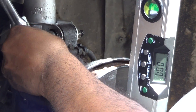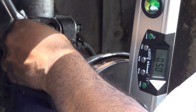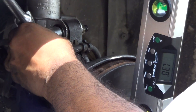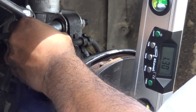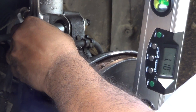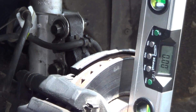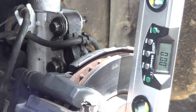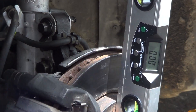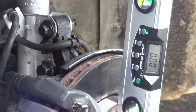After, you want that to be between one to two degrees, positive or negative. So you could adjust your camber bolt until it becomes zero again. Here it is zero, so we're pretty sure that the wheel is vertical, and you could go ahead and tighten up your bolt.